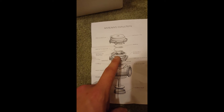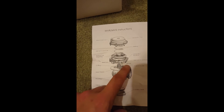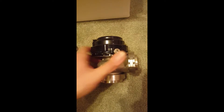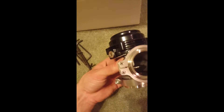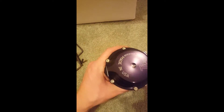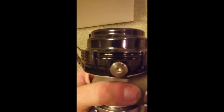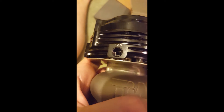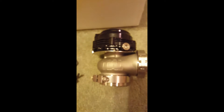It has the valve assembly and this actuator diaphragm right here. They explain this — you don't want to mess this up. The Tial wastegate that I ordered, I already put it together basically. So let's unbox this — here is the MVR 44 millimeter, comes with the v-bands. This is the first water-cooled wastegate assembly Tial offered. If you look here, it says H2O on one port and air on this one.